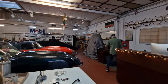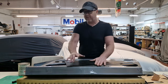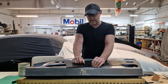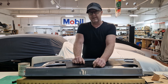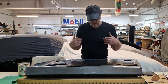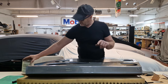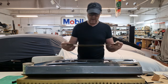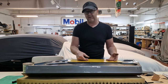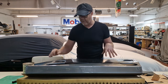I have already started with the doors because I tend to forget things. These are the doors, left outside. First advice: it's always good to have someone else make the mistake rather than you. Smart people say it's good to learn from mistakes, but the very smart people learn from those who have done these mistakes before — and you are the smarter ones. I learned that putting the anti-corrosion in first place is not a good idea, because you have to take all the grease off again to install the sound deadening mats, which are glued in. So my hottest advice is: install these mats first, and then spray that anti-corrosion over.